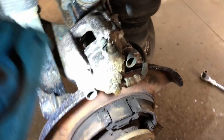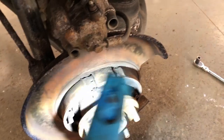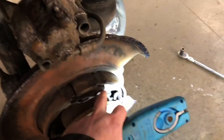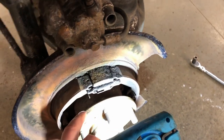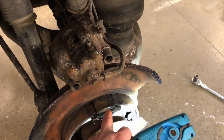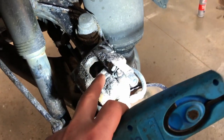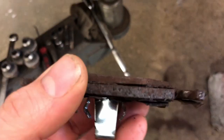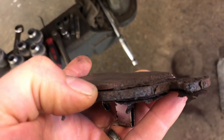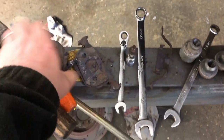The brake was binding on this side — there's a lot of crap inside there so I've blasted it out with brake cleaner and lubricated it, like I did on the other Range Rover, and WD-40'd all of it. I've just got to work the handbrake to make sure that's okay, then adjust it up. The caliper was seized — I don't know how long it's been like that. The pad is starting to separate — you can see where it's got so hot that the brake pad has started to break down. Both brake pads are basically knackered.